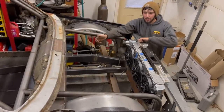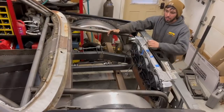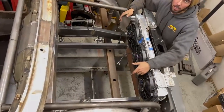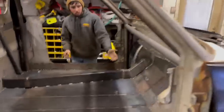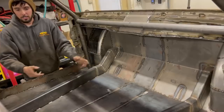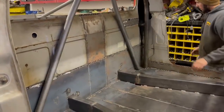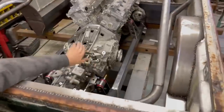After the body was all done being widened, the next step was to start the frame rails. The frame rails are made out of 2x4x3/16 square tubing. Up front, the distances were set by where I needed the upper control arms for the front suspension, and also to allow the radiator to sit down into them — the frame rails are actually going to serve as the coolant lines running through the car to the motor. I also had to keep them tight enough for the pedals to clear so you're not sitting too far past center, but then they had to kick in toward the back to hold the motor and have motor mounts going across.